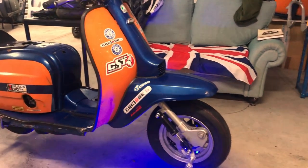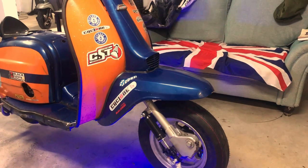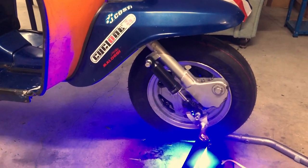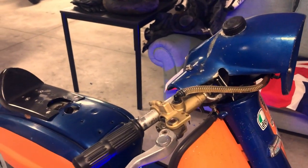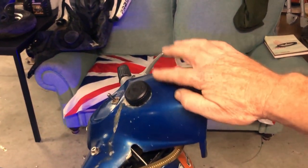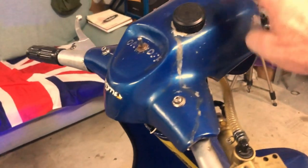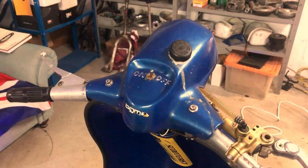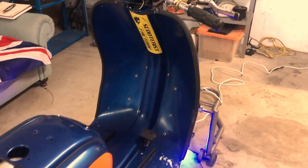Here's a quick walk around the bike. As you can see we've got BGM front dampers on there, and we're using some progressive springs. The front wheel is from a Derby Vamos, so it's a bit of a strange one which is one of my own creations. Up the top here we're running a Ducati master cylinder off a 748 with the reservoirs at the top. We've got the cutout switch on the handlebars. This is just a dummy fiberglass part on top with steel bars underneath - we're within the rules, so we can have metal bars and don't have to change bars every five minutes because we've already snapped quite a few sets.